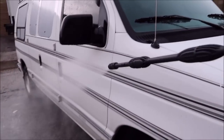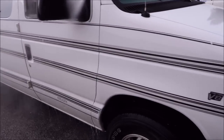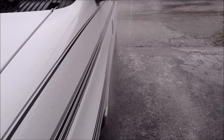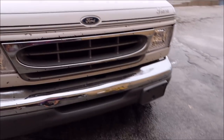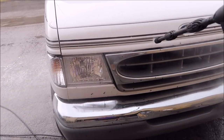You never want to get super close with the pressure washer — eight to ten inches is generally what I recommend. You're going to let the pressure do the work to get the bugs off instead of touching it with your hands and rubbing it in. Let the pressure do all the work. 1,500 PSI is really the max I would use on automotive paint.